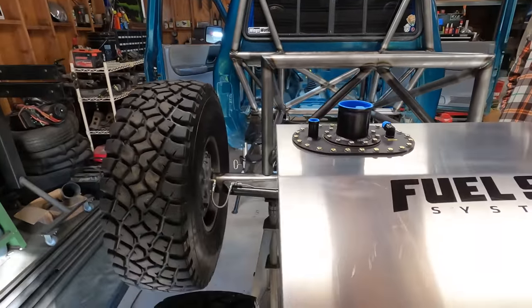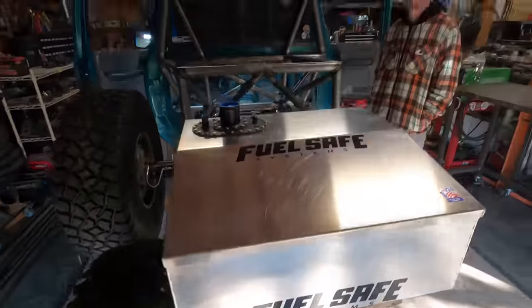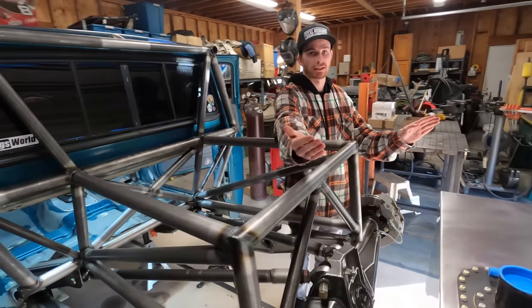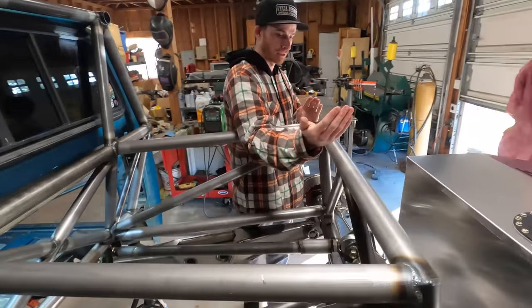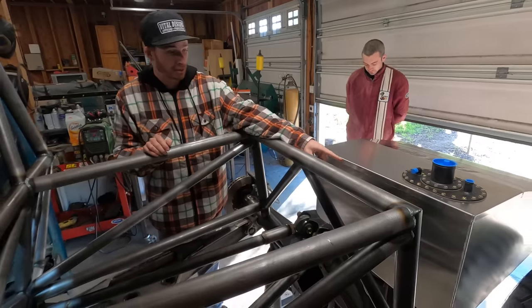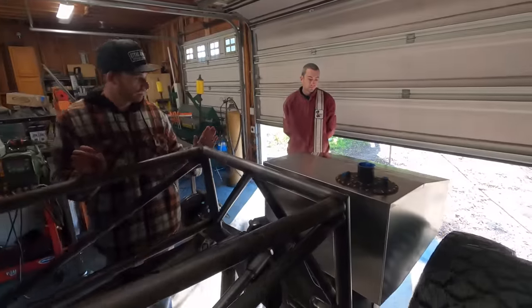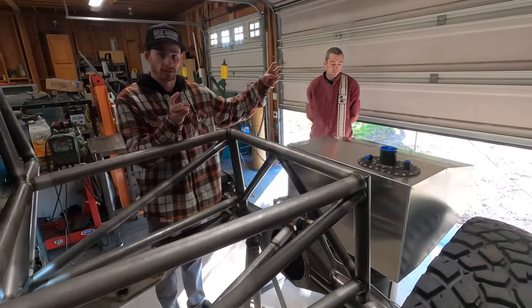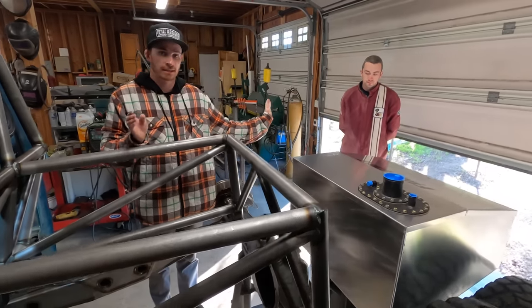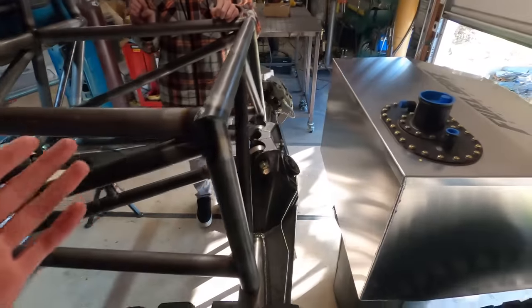One thing to figure out was width here. This section is wider than this section, but it's wider to be able to fit the fuel cell behind it — so nothing is bulging back out. You can see the kick on those tubes coming back. Those tubes will be able to come straight back off that and perfectly encapsulate the fuel cell. A lot of people do have the rear section taper wider behind where the axle is, but since we're going to be running the spares one on each side of the fuel cell standing straight up, I wanted this back section from the axle back — the fuel cell cradle — to be just straight back, so the tires are straight with everything.